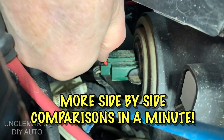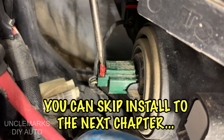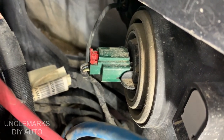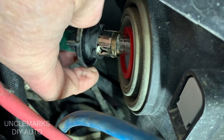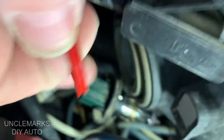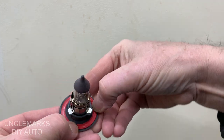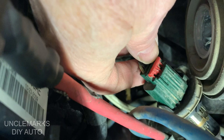On these Dodges they've got this red tab that you have to pull out — that's a locking tab. I have to use a little screwdriver to get it to move a little bit. The van's a 12-year-old van so it's possible there's dirt stuck in there making it hard to move. I want this to come out as far as it can; it'll stop once it's out. I'm going to leave the connector on the bulb because I think it'll be easier to put the bulb back in. Normally you don't want to touch the bulb at all — the pack came with a nice set of gloves. The ring here is like a moisture ring to keep moisture out; it was stuck on the headlight so make sure yours comes off. You don't want to be touching the glass because as it gets hot, if you have oils on your fingers it could cause the bulb to burn out prematurely.